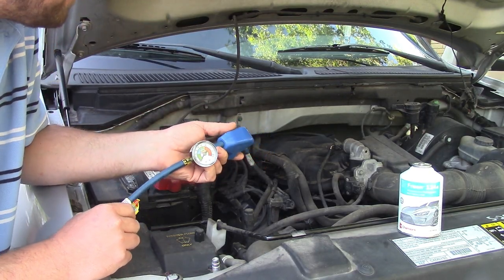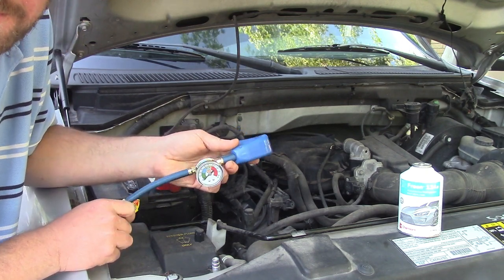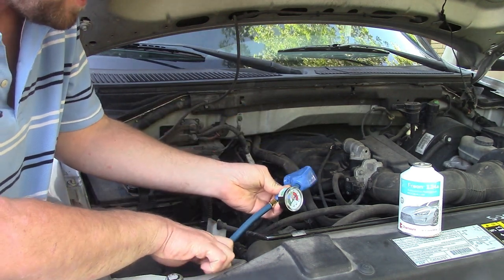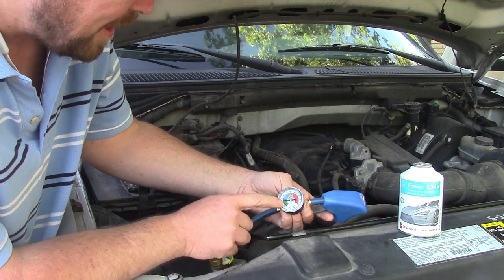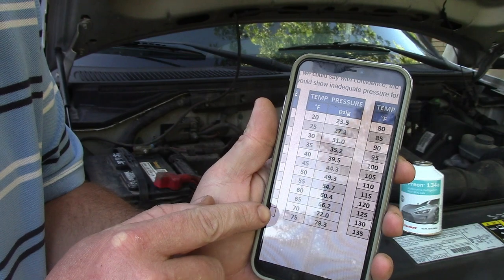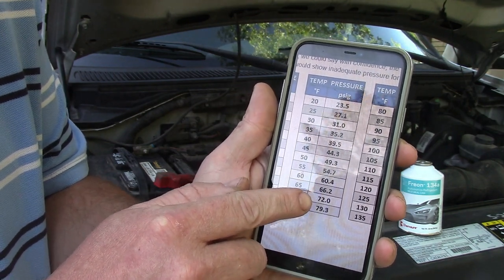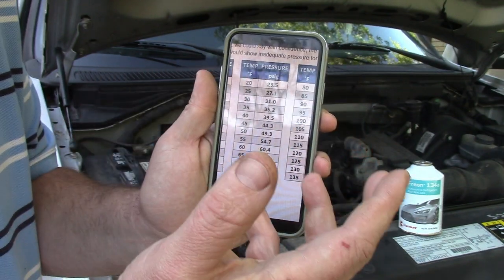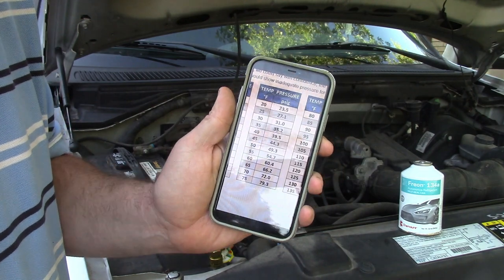Let's see what we can figure out from this system. The AC doesn't work — the AC compressor doesn't kick on when it's running. That means either something's broken or it's low pressure. So let's check our pressure. I'm on the low side of the unit. If we hook that on we can see we're around 15 pounds per the gauge — that's your static pressure. We're looking at a static pressure chart for R134A and it's 71 degrees right now. If we had liquid in the system the pressure should be reading around 72 PSIG. With us being at 15 that means there is no liquid left in the system — it is almost completely empty.